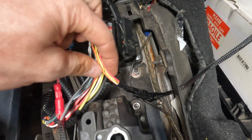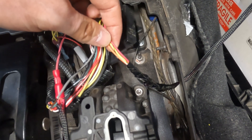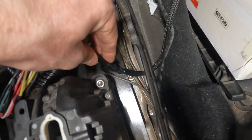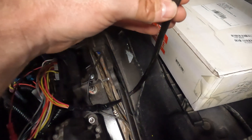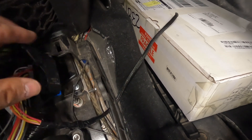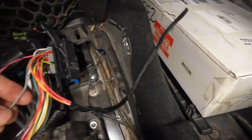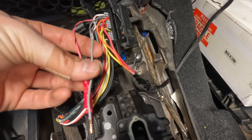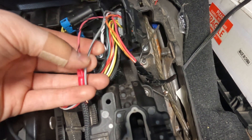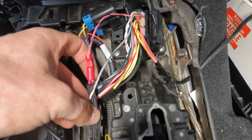So here you can see I've got three extra digital inputs. I've got them written down on the schematics, which shows which color goes to which. I have it wired coming out the side here so I can play around and see what other options we can do with this transmission. I kept digital input 1 under the actual plastic here so it can be for my sport mode, and then digital input 12 I have wired up to the lights.